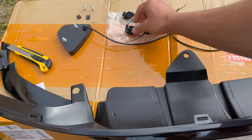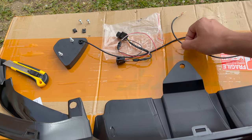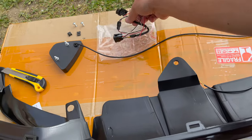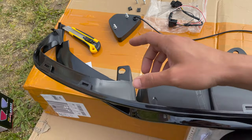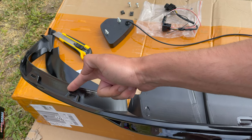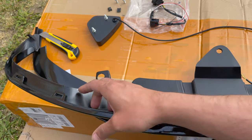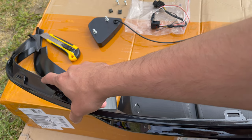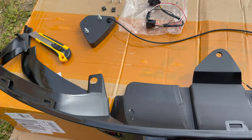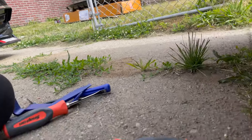They actually started sending these too, but I don't need them because you still have to wire them. It's better to just do it directly with three wires right to the tail light brake light — it's perfect. This one is more of a headache. I wish they also trimmed this piece from the middle area down, because it doesn't fit — there's a blockage by the exhaust area so we have to cut from around here up to here. I'm going to use cutting pliers and a blade on the sides.